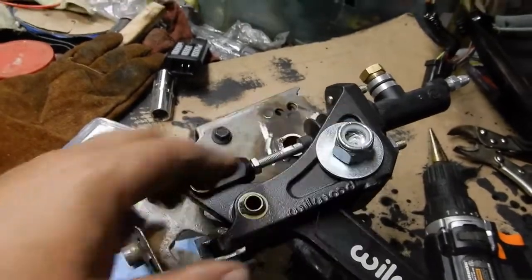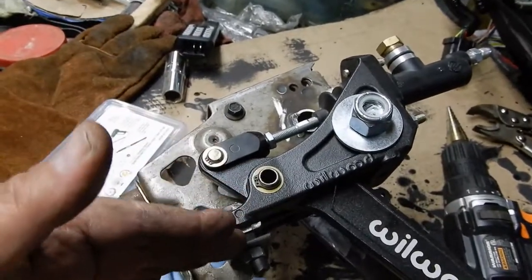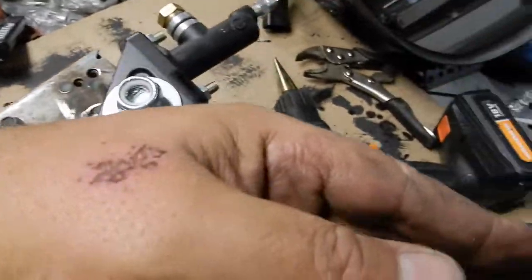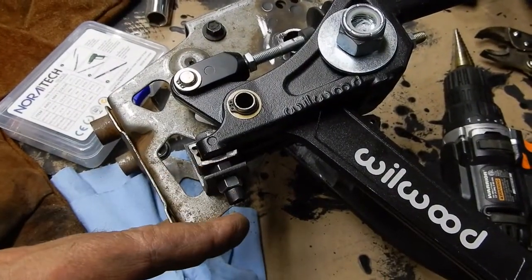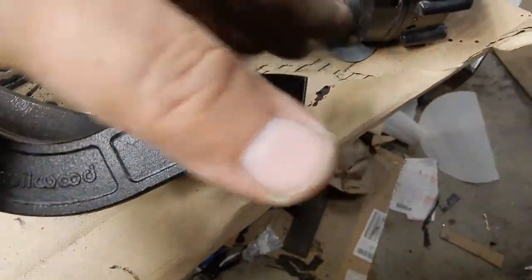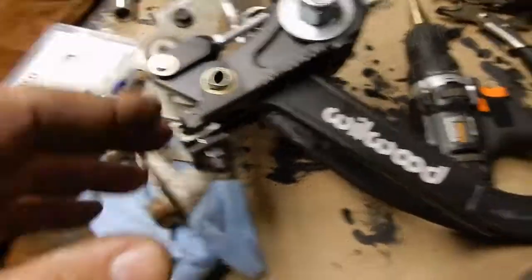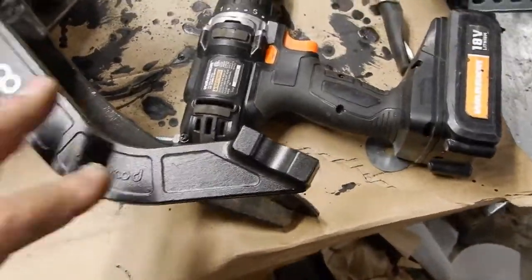After this, it will pinch and hold this thing in place. But there's a pivot here. There's a little bit of adjustment here, and what I plan on doing for adjustment is, if I need this arm to move more toward me, in this direction, I can get a longer bolt and just add nuts as necessary. If I need it closer to the floor, and I don't know if you can see it, but it's going to stick up toward me probably another 1/2 inch higher than the brake pedal, which is okay. I kind of like the clutch a little bit more toward me. It's used only by my left foot, so that's the plan. Going from the relative distance that I have in my GT, that's the way I'm going to do it.